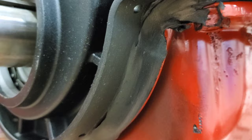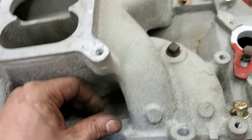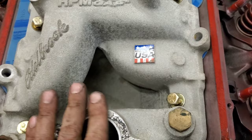What you have to do is put a bead of silicone in there to take up the space — it will work, it's not exactly ideal, but it will definitely work. The reason I bought some mark 4 parts is they are much easier to get than the gen 5 stuff, so I'm building a bit of a hybrid motor here. You torque these down to Edelbrock specifications, not the factory ones, because factory torque specs are made for a cast iron intake not an aluminum one. This is the Performer RPM Air Gap — one of my favorite intakes for street use. It builds a lot of torque and makes good horsepower as well.